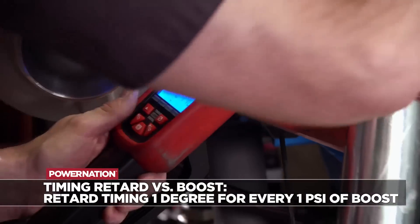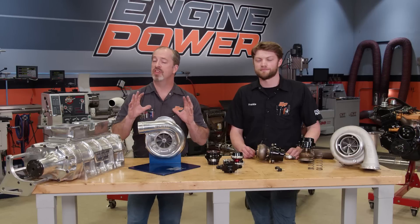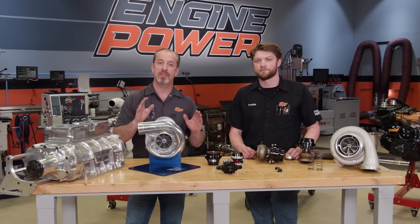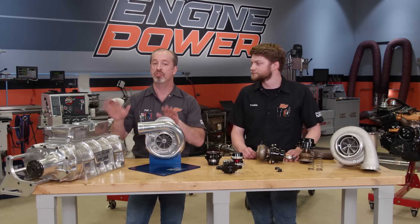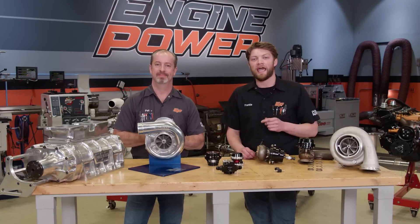The other side of tuning is timing. We do need to reduce timing with the amount of boost because we are increasing the cylinder pressure of the engine. As a general rule, we will pull one degree of timing for every one PSI of boost we are adding — and that is for pump gas. Remember, all these values change if you are using a better fuel; you can get more aggressive with the tune-up running race gas, ethanol, or methanol. This is just a general overview and we are just scratching the surface on artificial aspiration, whether it's supercharged or turbocharged. We hope this video helped you out for the next time you are going to boost your engine, and make sure you subscribe to see all of the latest Power Nation videos.